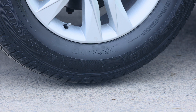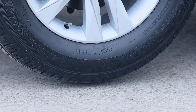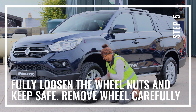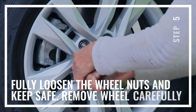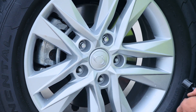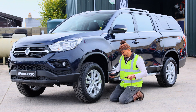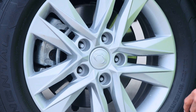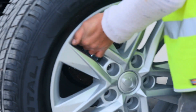We don't want to take it too far up because that will leave us struggling to fit the new wheel once we try and fit it. We can now fully release the wheel nuts — keep them nice and safe. Use the box that the special adapter came in to place them in. Now the wheel's ready to come off. Your spare should already have been removed so that you're ready to replace it quickly.